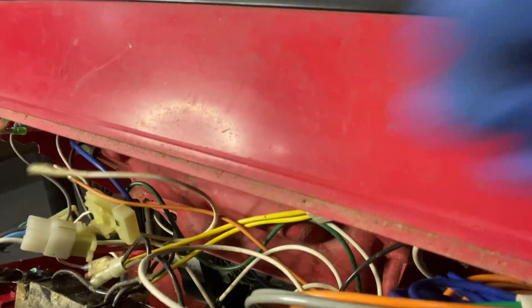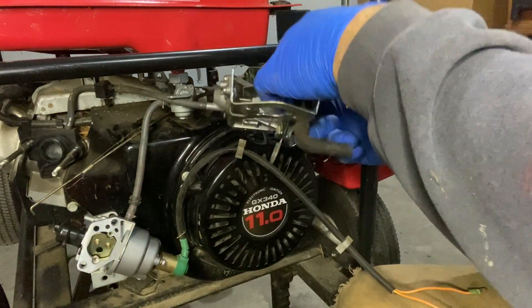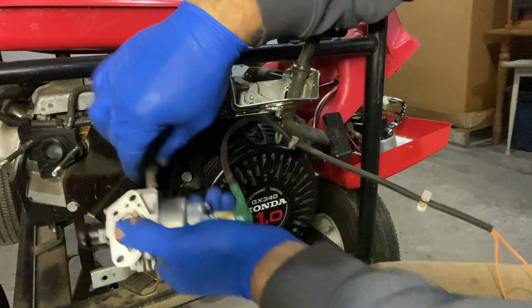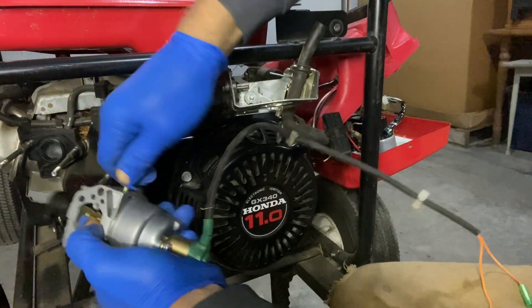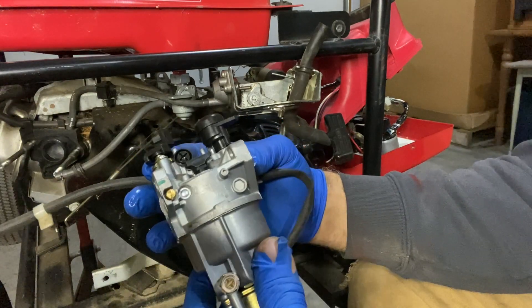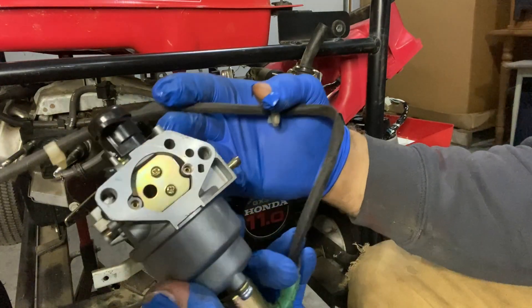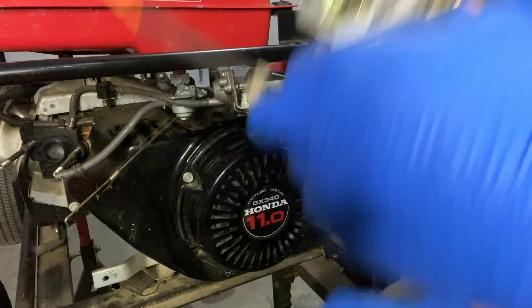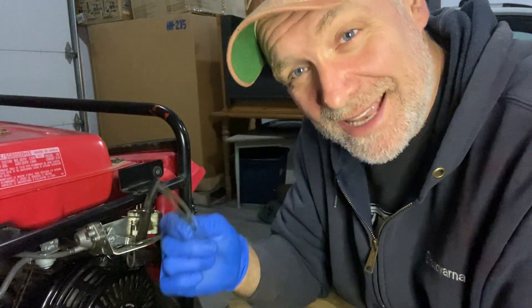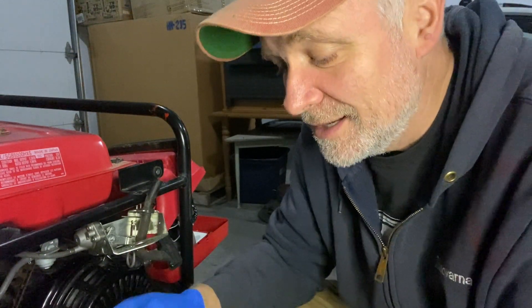Pull it out through the grommet. Now we just got to take the fuel line off. I'm definitely going to keep this carburetor as a backup in case I ever need to use it. I'm going to take this screw out and drain the rest of the bowl — that'll be a good backup. The only thing I wish they had in the kit extra was basically a gasket — they didn't send the gasket with it. I always recommend you change your gasket, but this gasket came off in one piece so I'm going to reuse it because I want to get this thing up and running.